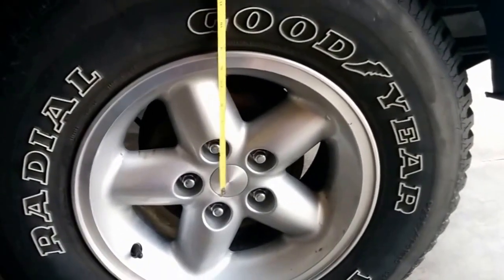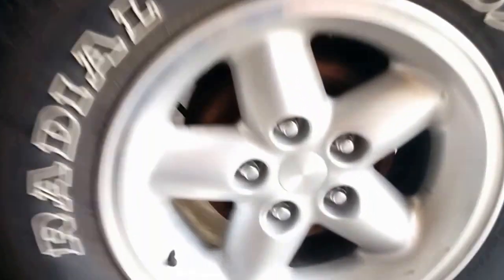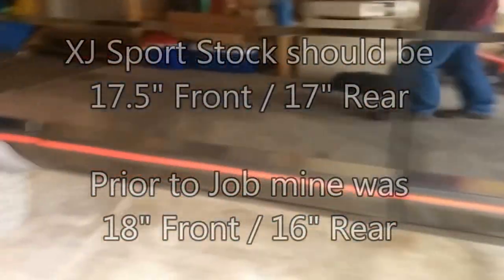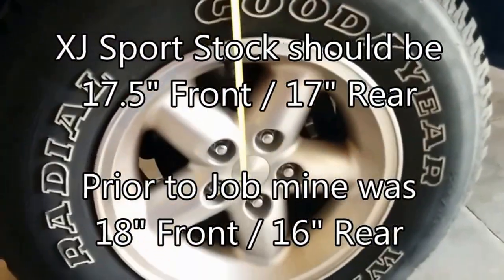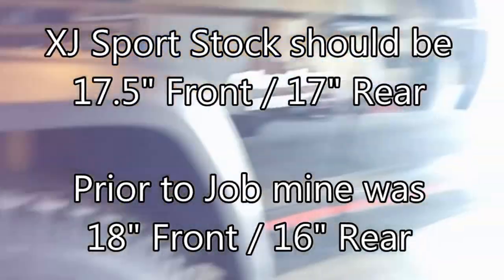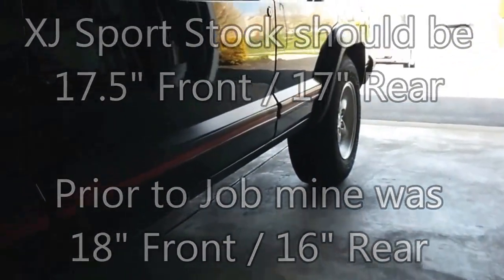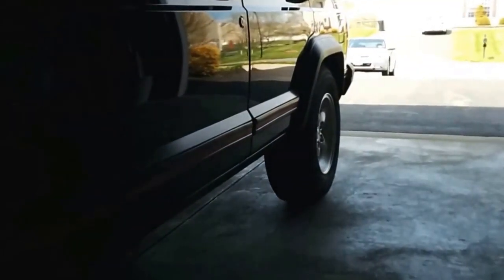With most the weight out of the Jeep we're looking at 16 inches from the center to the fender. On the front we're dealing with about 18 and a half, maybe 18. So we got low in the back — I got most of the weight out of the back — and a little high in the front. So we're at least half inch high in the front and a good solid inch low in the back.